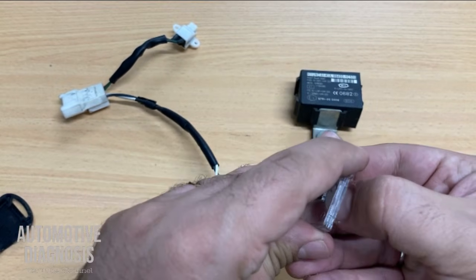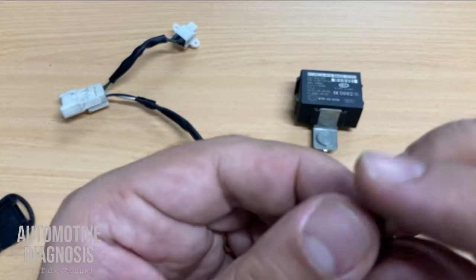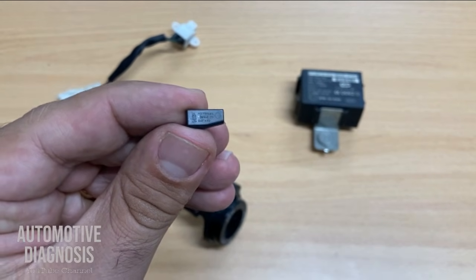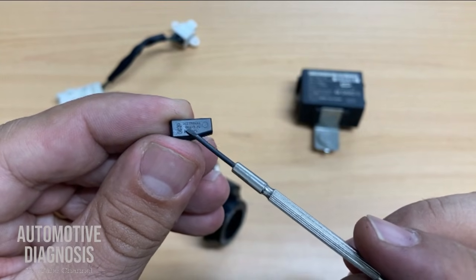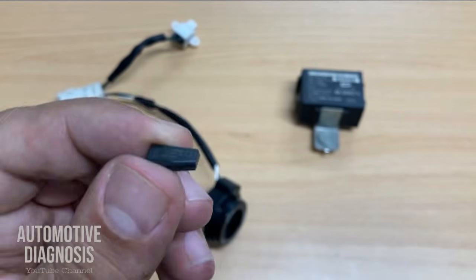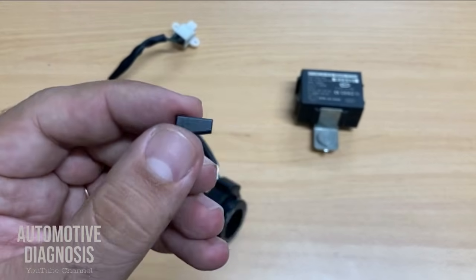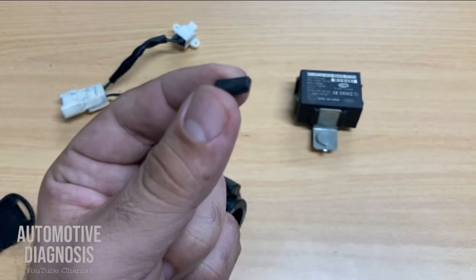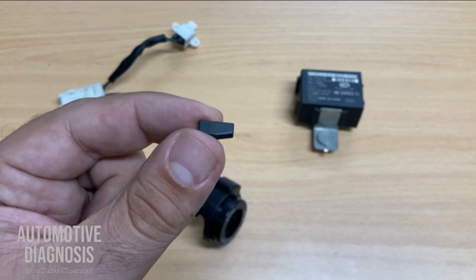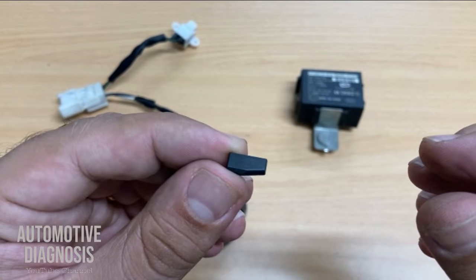This is the chip itself. As you can see, there is a number written on the transponder chip. Anytime you want to order a brand new one, you can just use this number. But if you replace the transponder chip with a brand new one, you have to perform key programming. If you lose this one or have to replace it, you need to perform key programming — this is really important, because without this chip you won't be able to start the engine.